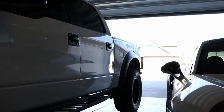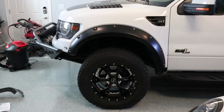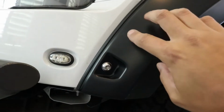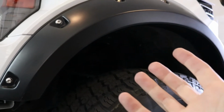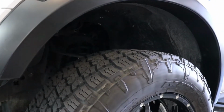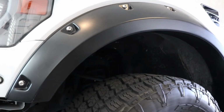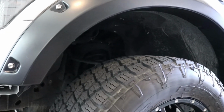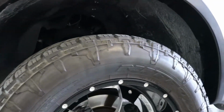It is the next morning. The fender flare is on, so that's pretty exciting. So I had this idea, and I started thinking maybe this rubber seal was what was in the way. So I couldn't push the fender up enough to get those clips in. And so I just wet the body down so the rubber would slide a bit. And then I was able to shove those retaining clips into that wheel well area.